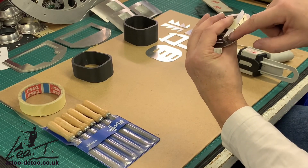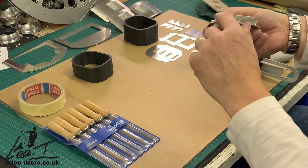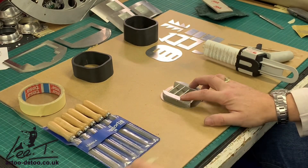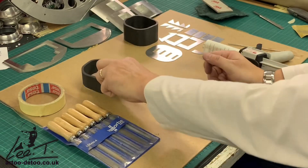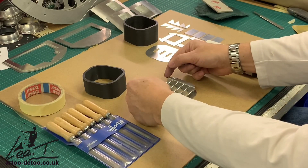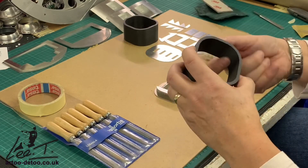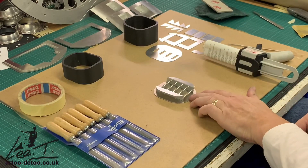Once these are all glued in with your two-part glue they will not come out and it will keep everything stable. You could also glue it to the back plate — just run a bead along the back of this angled section onto the back plate, and the same there as well. Then once it's dry, take your masking tape off. Once that's done you should be able to just slide this over. Now if it's still a tight fit, you can get your files and just concentrate on the top and bottom edges. That should sort it out — so that's the small vent done.